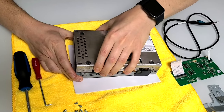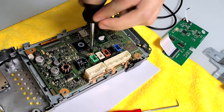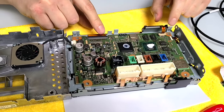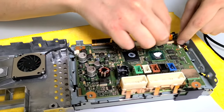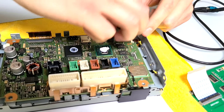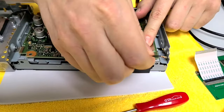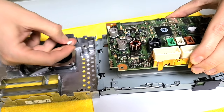Next we can separate the screen from the aluminum back. There's a bolt right inside in the middle which you have to unscrew. Then you can use your fingers, or our hook tool if needed, to remove the video connections. There's the first one — you just flip it up and disconnect it. The next one you have to pull the plastic towards the top to release the clip, then disconnect it. The small one you have to lift up and disconnect. There's also another wire — just pull it towards the top. Now the motherboard can come out; press on the clip and remove the last connection.